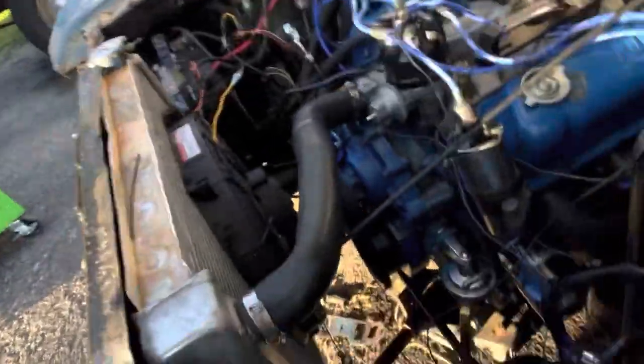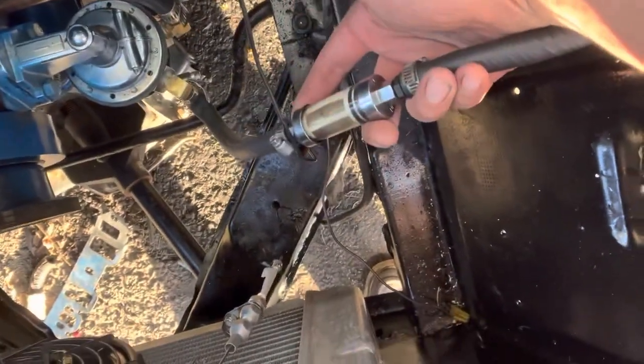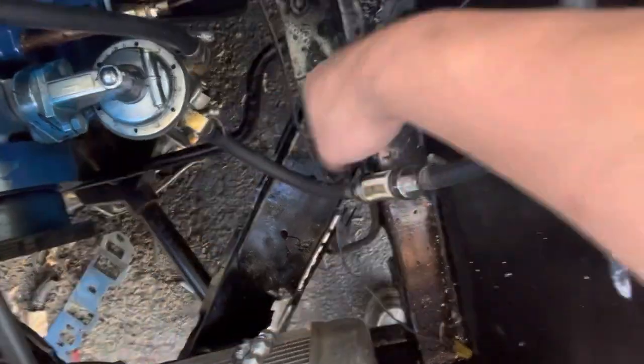Running the crap out of it and letting it sit and run. Based on the amount of crap I found on the fuel line down here — I don't know if you guys can see that at all but it is filthy, absolutely filthy. So I'm going to pop this line off, blow this filter out. That was from the initial startup running through the stock lines still on the car — the front half is new, the back half is still old.